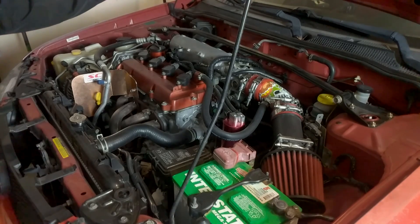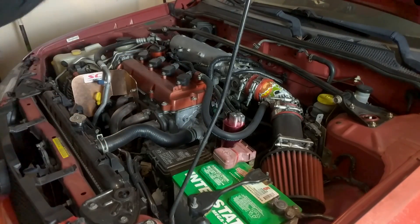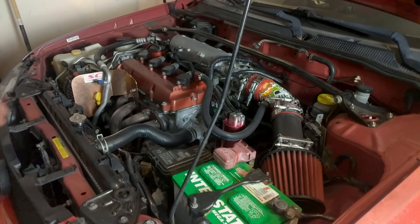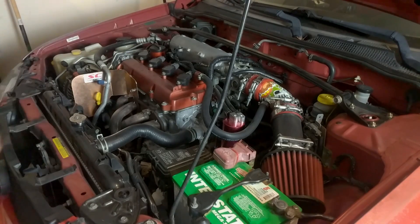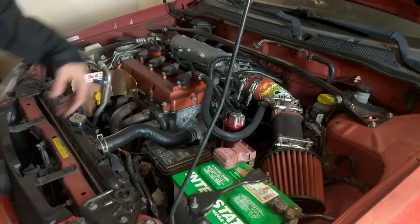Before I leave you guys today, the last point of discussion is oil consumption with these engines. You might have noticed that I have this red canister attached to my engine, and that, my friends, is a catch can. I installed this a while back and made a video of it, but the basic premise is that when the engine burns oil and releases it through the valve cover PCV valve at the top of the engine, it must first go through this catch can before it goes back into the intake manifold. Since both the exhaust manifold issue and the intake manifold issue are characterized by more oil burning, it's a very common preventative maintenance thing on these engines to get a catch can in the system. I noticed myself that I had less oil burning after I put it in, as mine works more as an expansion tank, allowing the oil to go through before it goes back into the intake manifold and is combusted along with the gas.